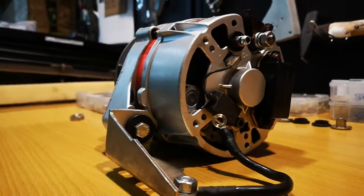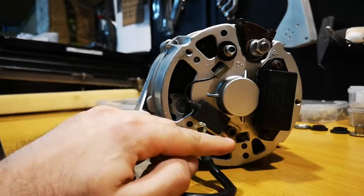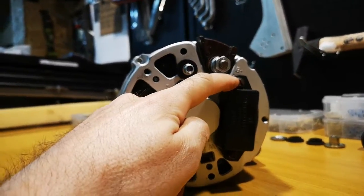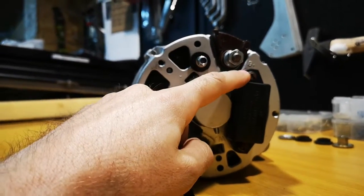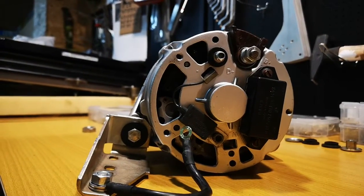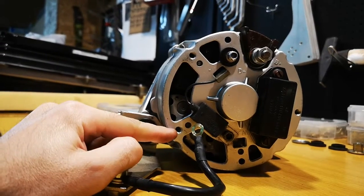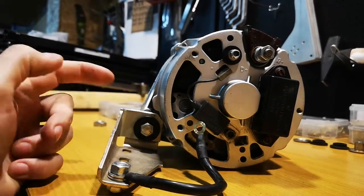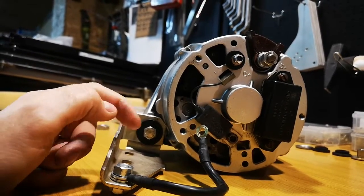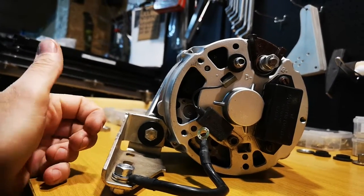The other thing is, because the housing was painted, there was paint in the holes under the capacitor and also where the regulator makes contact with the housing. That's something you have to remember — wherever you make an electrical contact, the thread itself can provide a contact, but it's good practice to also clean the surfaces where you require electrical contact.